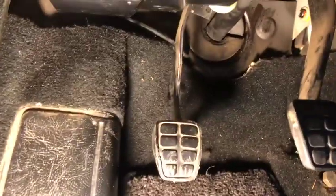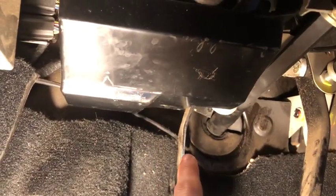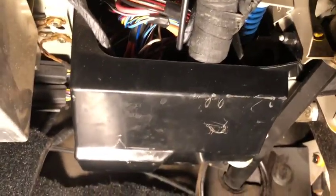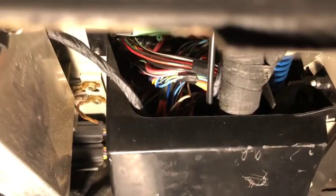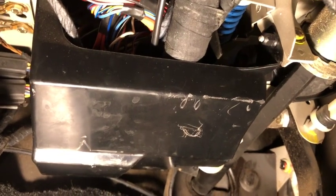In the car we've got the clutch pedal here. This black cover needs to come off — there's a little pin and a locking tab we're going to pull, which will help release the push rod in the back. There's a plastic nut right there, and one up in the corner. We'll remove those; there might be another one back there but we'll find them and pull that cover off.